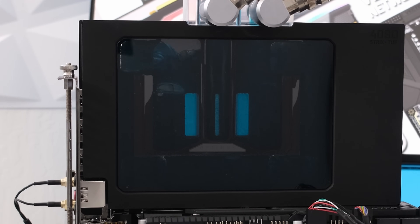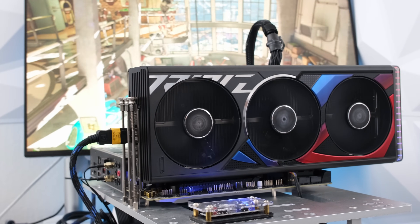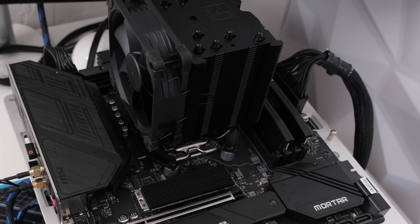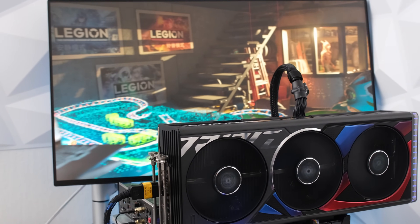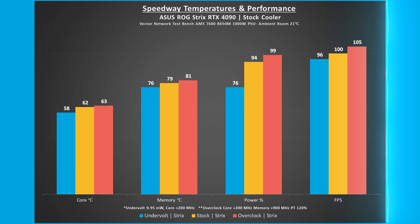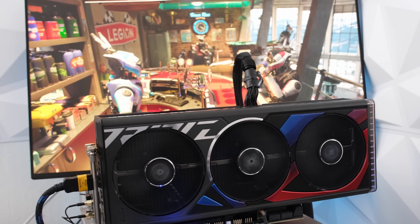Using Mayhem's X1 Blue Coolant, the saturation is blue tinted, and the blue is brighter around the nickel-plated copper cold plate. The fill and leak tests are complete, so the testing is next. For comparison, we have first tested the ROG Strix RTX 4090 using its stock air cooler. The test bench is a 6-core CPU with an air cooler on AM5 with a 1000W power supply. The default performance BIOS was used, and 3DMark Speedway stress test was run on our open-air test bench with ambient room temperature at 21 degrees Celsius. At stock, the GPU core and memory temperatures were 62 and 79 degrees Celsius respectively. Undervolting resulted in marginal decreases in temps and FPS and a significant decrease in power consumption; overclocking increased temps, power, and FPS in the low single-digit percentages across the board.